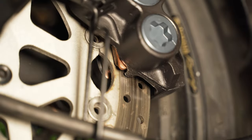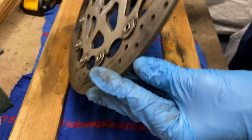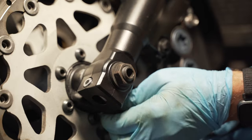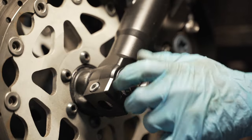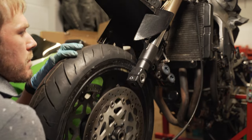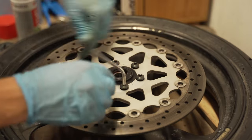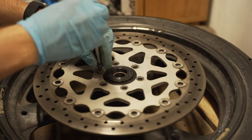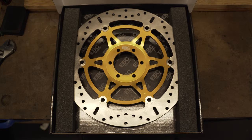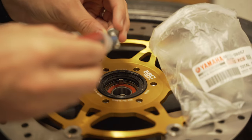On the subject of brakes, I noticed something really worrying about the front discs. The friction material on the pads was very close to the bobbins, and on the inside they actually fouled on them. It turns out the '94 model discs are slightly different and aren't compatible with the Bluespot conversion, so I needed to get hold of some earlier discs. I decided to get a brand new set from EBC. I also took the opportunity to put new disc bolts back in.